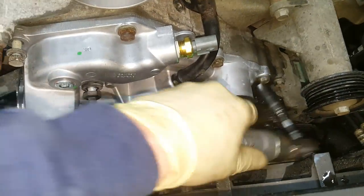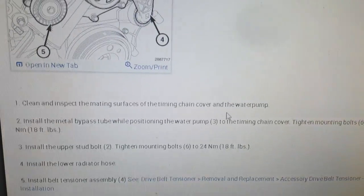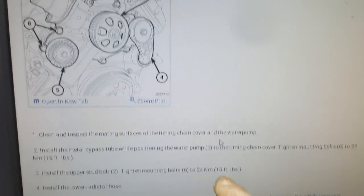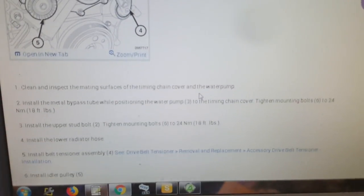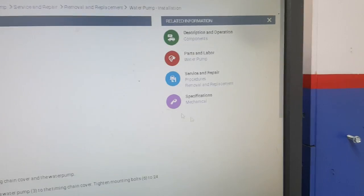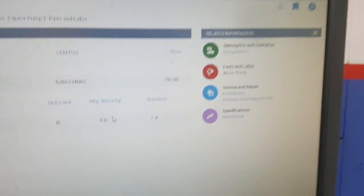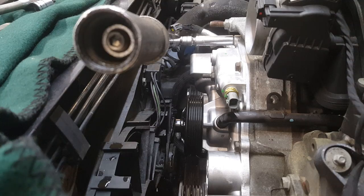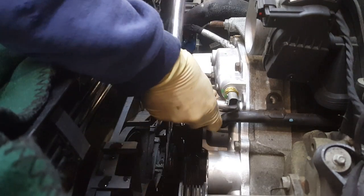We got this all set up here — I'm just going to zip all these in with my air ratchet to save some time, and then we're going to go around with a torque wrench and torque these to 18 foot-pounds or 24 Newton meters. It shows you the sequence in which you should be tightening these as well — you can pause the video and take a closer look at that if you need to. The standard labor time on this is 1.4 hours, so it's a relatively easy job — definitely something you can do at home in your driveway. And now we're just going to go around and torque all these to 18 foot-pounds.